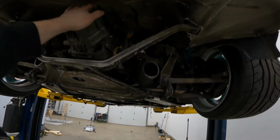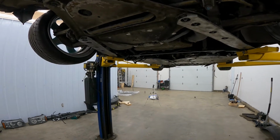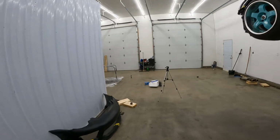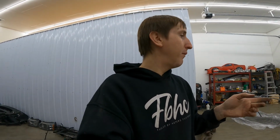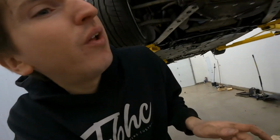Now, what do we need to do? Well, I think we gotta jump into the wiring. But before we get to the wiring itself, we kinda gotta figure out the water pump. Or do we? Technically, if we just start it up and don't let it heat up, we don't need the water pump. Because for the water pump, I need to go to a store to get some fittings, get some lines, and so on.